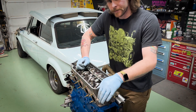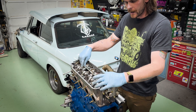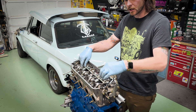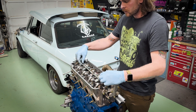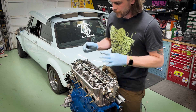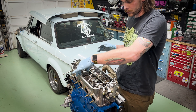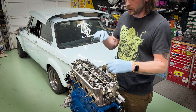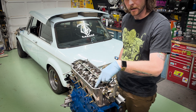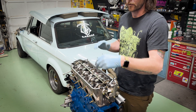I have number 1 at top dead center on the compression stroke, which puts number 4 at top dead center on the exhaust stroke - which you don't want because it's still slightly touching the rocker on the camshaft. So you want to make sure they are completely loose, not touching at all. With number 1 at TDC on the compression stroke, we've got the intake valve on number 2 and the exhaust valve on number 3 that we can do. Then we'll rotate it 180 degrees and get number 4 at TDC, which makes the intake of number 3 and the exhaust of number 2 completely loose.